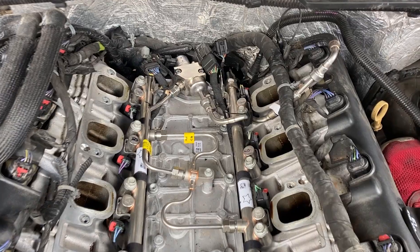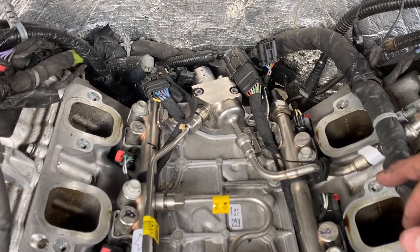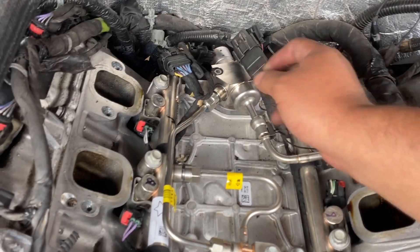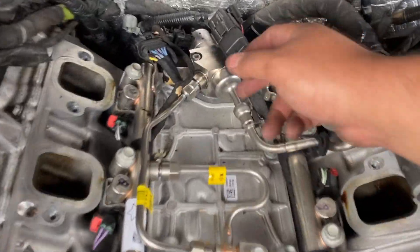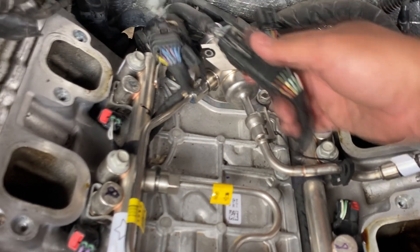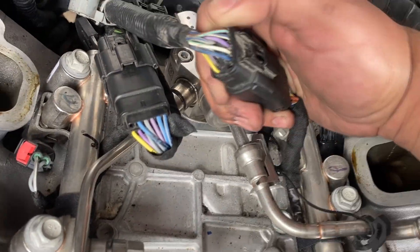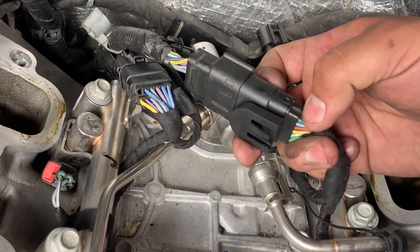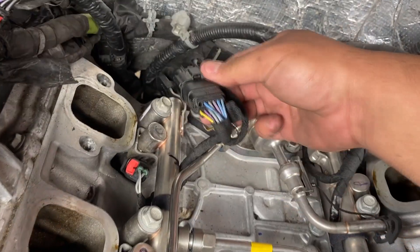After checking the wiring diagram and back-tracing it, I found that the fuel rail pressure sensor wiring harness connects to a bulk harness before it reaches the main harness. There are actually two of them — a harness on each side of the fuel rail — and both connectors link everything up to the main wiring harness. When I took a close look, I could see this brown and yellow wire at the corner, but flipping it over, there's nothing connected in that cavity. Also, the green and black wire that should be our ground connects over to a yellow wire on the other side.